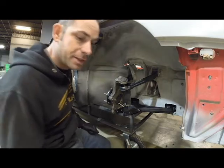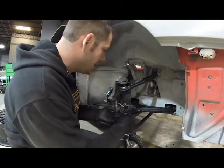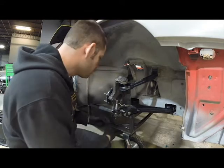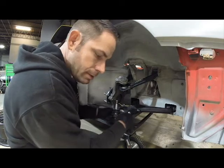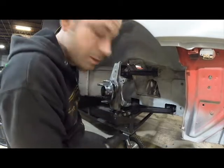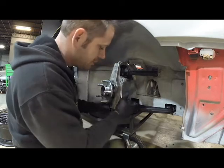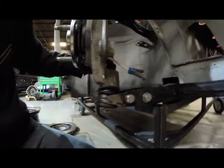We're back over here by the car and we're going to do a super quick fit-up — we're not going to bolt everything in or on, just fit it up and see where we're at generally. Now that we've got this in, we can see where our camber is going to be at for the spindle. It bolts right onto the factory lower control arm mount where it normally would. Spindle goes up, looks fine.